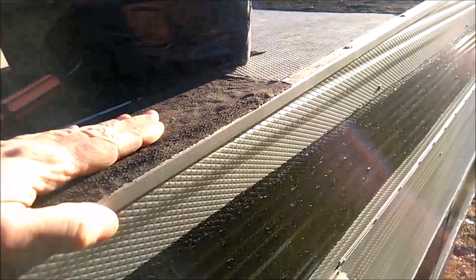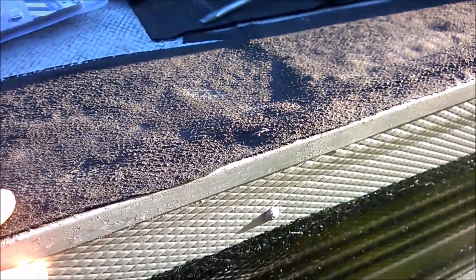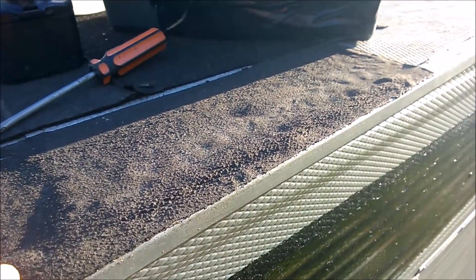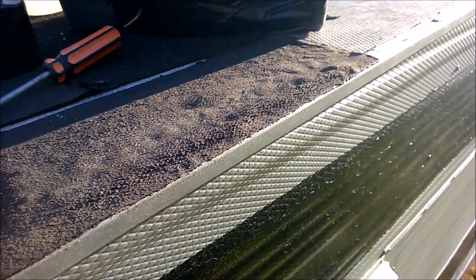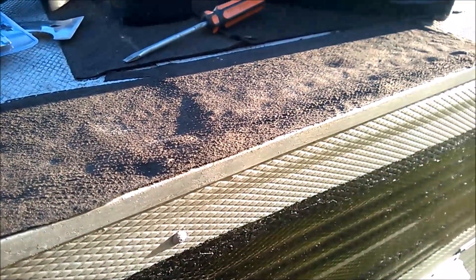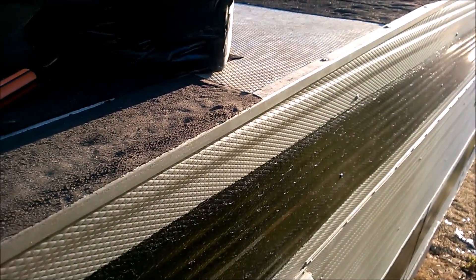This side is actually quite clean - it's only these flathead screws I've got to take out. The idea is once I've taken those out, I'll be cleaning underneath both the rail itself and the mating surfaces - the ceiling and the walls - and then I'll be applying butyl mastic. Previously with the Millard I used Sikaflex, which is a great product except it's also an adhesive, so if I needed to pull things apart it'd be pretty difficult. So I'm going to stick to the butyl mastic this time.